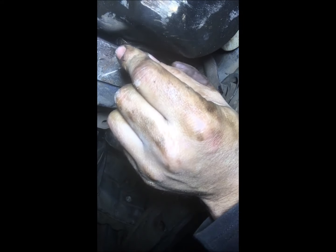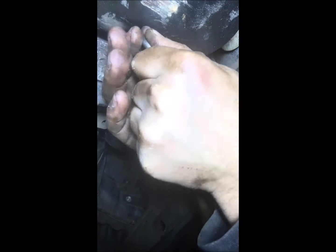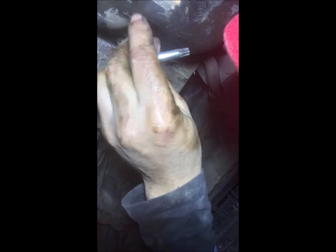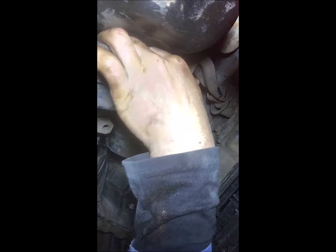After I removed that plate with the two 11-millimeter bolts, I actually saw there is another spline here. You have to remove that plate to get to this spline, which is the last spline on your sump. Once you've loosened this one, your whole sump will come loose easily. But never force your sump — always check that you've loosened every single bolt before you try to take it out, because sometimes you think you've taken out all the bolts and there's one hidden bolt.